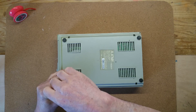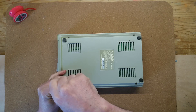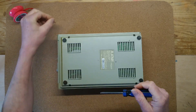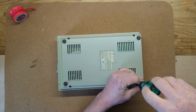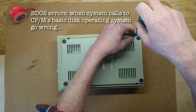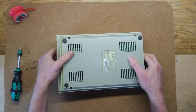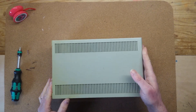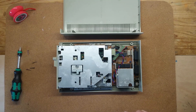Transferring CP/M applications to the Indus is not easy. I tried using an SIO to USB as a second drive but I kept getting BDOS errors. I also tried an old SIO to PC serial cable using a Max 232 as well as several PL2303 cables, and basically nothing would work. It became clear that I'd have to hook up a second drive.